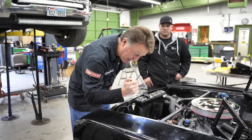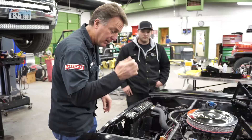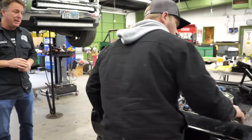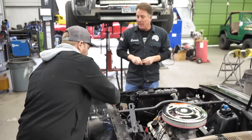I know enough about this original tag. If I was in the field and we couldn't take the car apart and we're about to spend big money, what I'd like to do is take one rivet off and turn the tag to reveal the K code number. Since this one's never been taken off, I want to leave it. We're going to take the fender off since we have this in the shop and have the luxury. But if you're out chasing around and looking at one, you would not be able to do this.